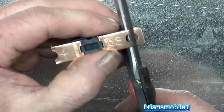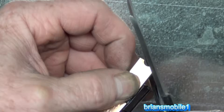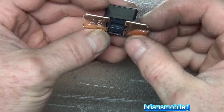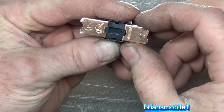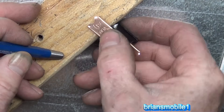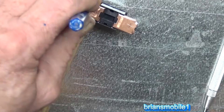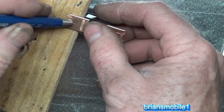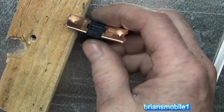There's your hefty kitchen scissors — get her done. I'm going to smooth the edges so nobody gets cut on it. Now we just need to drill some holes. If we wanted to, we could just cut V's into it and screw it down by the V's, but we're going to go ahead and drill holes. This costs about $4. I'm going to hang this off the edge so I can do it upside down. I'll take my punch and line it up, start with a small hole in the center and then work out to a bigger one. If you start with a big hole, often the drill will grab hold of it, spin it around, and rip things out — then you've modified it so you can't return it. Go slow by doing a small hole first. The wood block helps keep it flat on the other side so it doesn't just punch through.